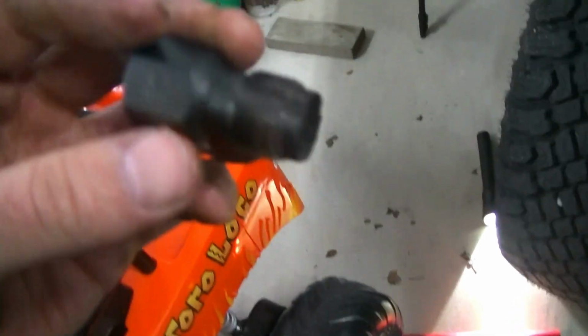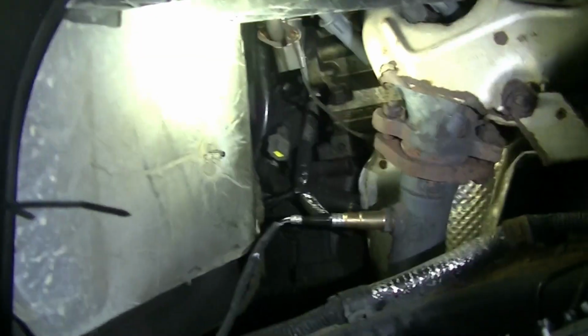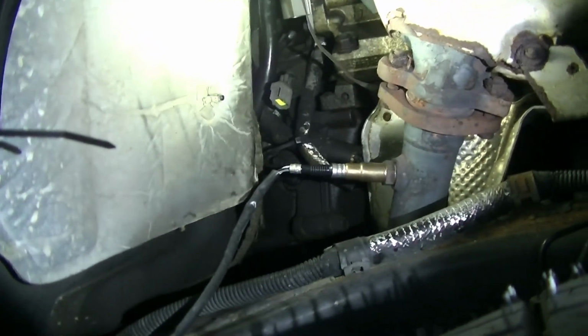Alright guys, we went ahead and chased those threads. I'll put a link to one of these in the description below as well. These will save you a lot of money and save you from messing up your exhaust pipe or your new oxygen sensor, because now we know those threads are nice and clean. So we're going to go ahead and thread this bad boy in. Alright guys, we got our new sensor threaded in by hand. We're just going to go ahead with our wrench and a ratchet, snug it down and plug it in.